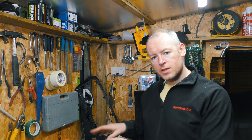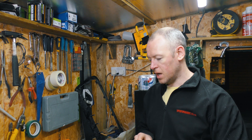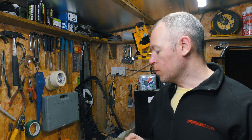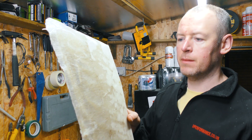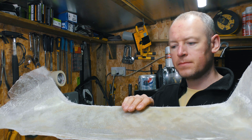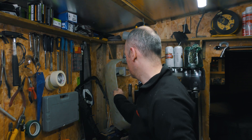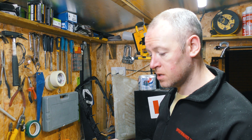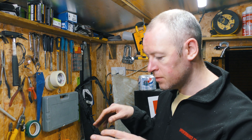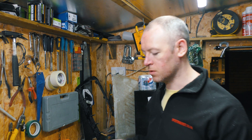I've done this off camera because the sanding has taken about three hours — it's just too much for a video. But I made good progress. I invested my time in this plug version idea and after trimming it up and having a good look at it, I was going to work on both at the same time, but actually this is going to be way more effort for an arguably worse result. So this is going to be my hood scoop — I just need to mix up a bit of epoxy to fill in some of the gaps, then do a full coat of epoxy over the top so that I can cast from it.